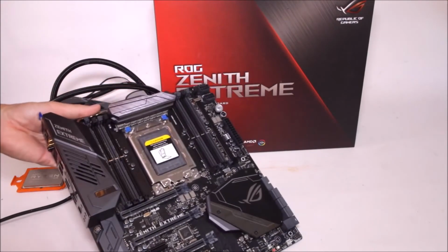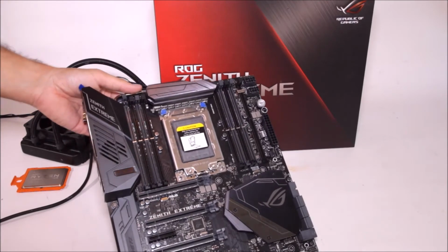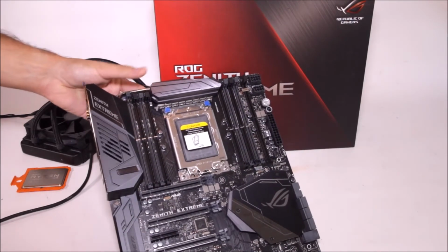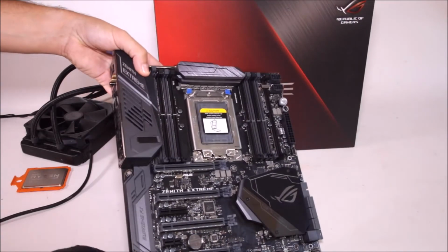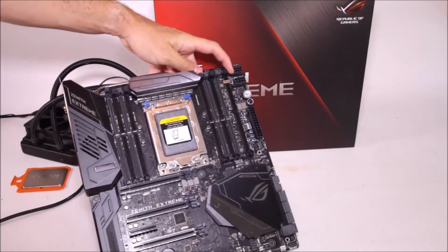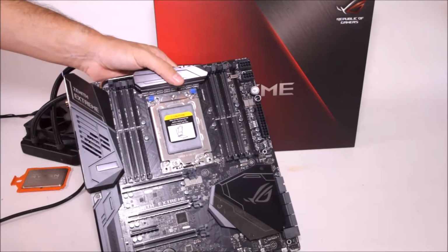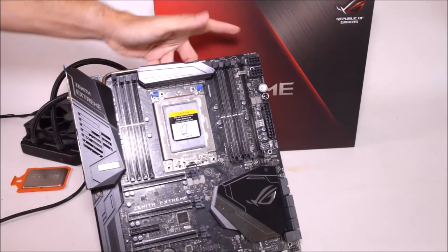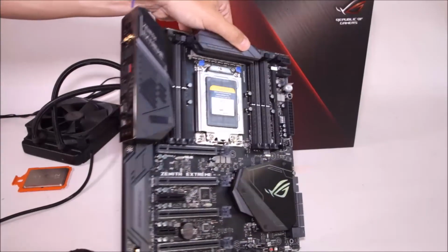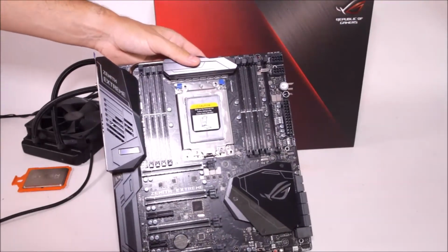Okay, I think we're back, and as you can see here, I've got ASUS's crazy ROG Zenith Extreme motherboard. This is probably going to be the biggest and most expensive X399 motherboard that anybody produces, I think. It's pretty crazy. They've got loads and loads of features on this board. You've got onboard Wi-Fi, you've got ASUS's uprated audio, M.2 ports, including one port that actually sits in this 9th DIMM slot. Over the edge here, there's an adapter in the box that you can slot an M.2 SSD onto and plug into that DIMM slot, so that's kind of crazy. You've got 2 8-pin EPS 12 volt connectors as well, U.2, USB 3.1, and you've got Type C and Type A ports on the back there, so all in all it's an absolutely crazy motherboard.